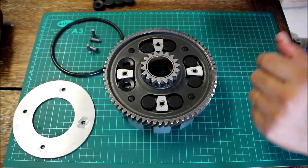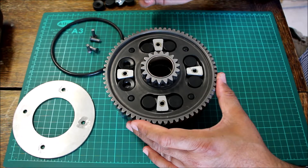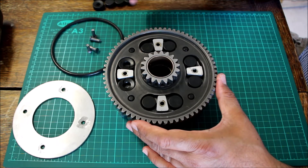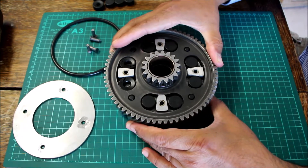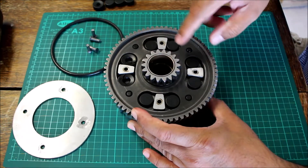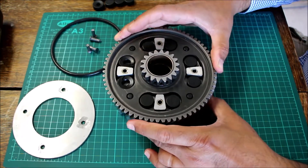The main function of this polo rubber or ring-type rubber is to perform the initial engagement and smooth out any micro vibration, torque fluctuation, or anything that could lead to unnecessary vibration, noise, or harshness in the transmission. Yamaha could have removed this rotational freedom if they wanted to. Similar to cars — dual mass flywheel or the springs in a single diaphragm dry clutch — this basket is constantly managing torsional vibration. On acceleration it transfers force to one side; on deceleration it transfers to the other.